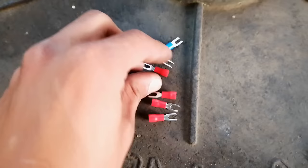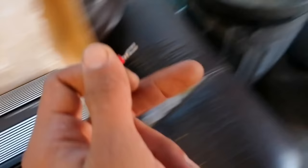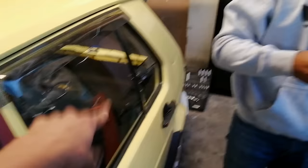What Jamie and I are going to do right now is fit these speaker terminals. This makes your setup look way neater because we'll be sliding them into the channel sections. The red will be for positive and the blue for negative. On the other ends of the wires we'll install speaker terminals as well. We're doing all four wires - two four-meter wires running to the front mids and two two-meter wires running to the 6x9s at the back.